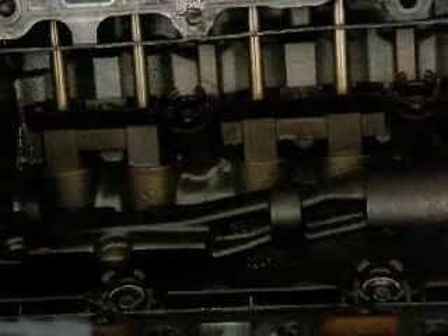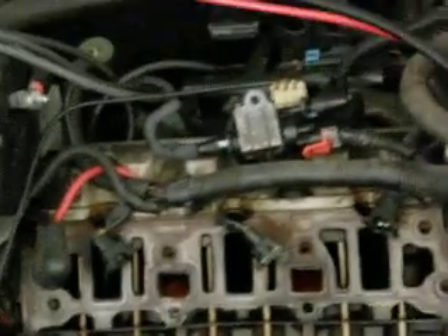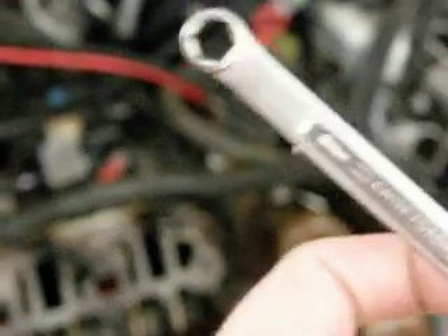This is for the water pump, actually — it goes over here on the side and this spins to circulate the coolant about. On the side of the intake manifold it had those two bolts on the side. All you've got to do when you have the intake manifold off to drain it is take an 8mm wrench and just loosen up those two bolts. If you've already got the charger off, you can get at it really easy. Drain your coolant from your intake manifold and be on your way.